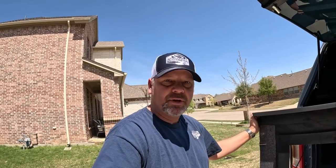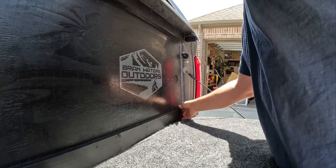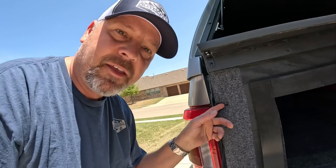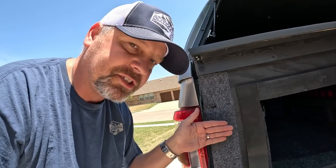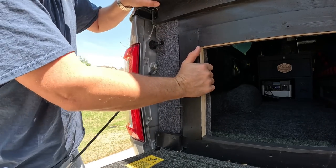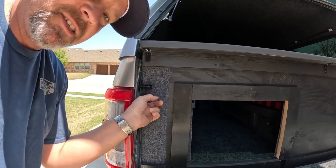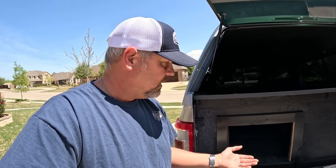I have it out now and I'm going to show you how I put it in. I built it pretty tight to eliminate any gaps, so it's a little tricky to get in, but it's really the only way to make sure you have as minimum gaps as possible. To start, you put the right side in behind that tailgate latch. Over here on the left, there's a small notch where this tailgate latch goes through and then it falls down and holds it into place. Then I put those braces on to keep it up and slide in the air conditioning unit.